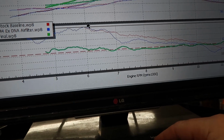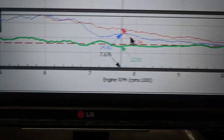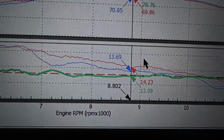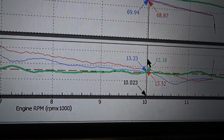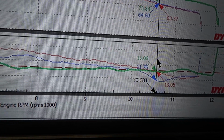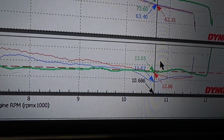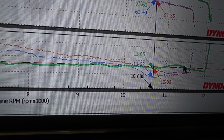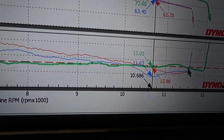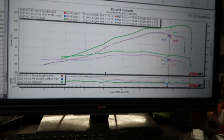Also, like we always do, we go over these final air fuel numbers too. We have a nice solid curve, even though this ETV mapping is a little tricky. Still have a nice clean air fuel. Have a little bit of variation there with the air fuel, again with the throttle changes. And then again, we clean up all these tiny little issues here, like this is a 2% rate of change. Here's another 2% or so. We always do a little tweak at the end and then send it on its way.